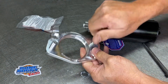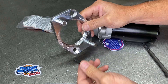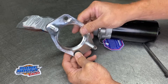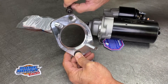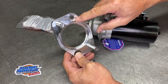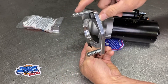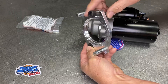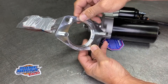From there, we have to remove the factory lower stud for the starter, and we're going to use this to install it on the bell housing. We can use an Allen bolt, or you can reuse your factory bolt. The factory bolt definitely works because it's got a nice thin head. If you use the Allen bolt, we either have to grind the bolt or clearance the starter to make it work. So reuse your factory upper bolt — that is going to be the best.